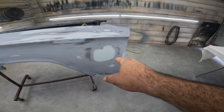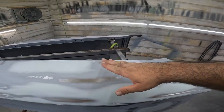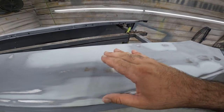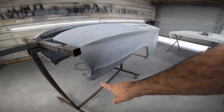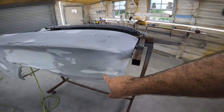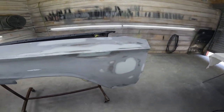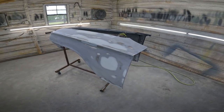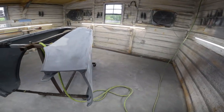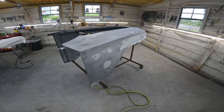I believe that was the dent - I tapped that in. Same thing down here, just factory stamping stuff. Same thing here - you can see where I circled with a pencil. Once you see the pencil you know you're there. Flattened that out. Front side was real good, a little bit down there. That side was pretty good, had a little crease there, not too bad. I'm going to get these things in epoxy. I just wax-and-greased them. It's 91 degrees in here, so I'll sit about another 15 minutes to let it evaporate, then get it back in epoxy. They're going to need another round of 180.